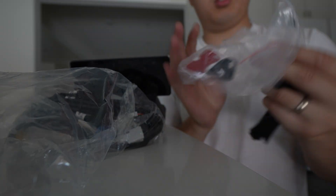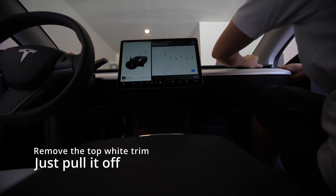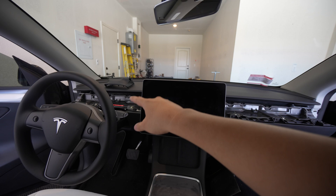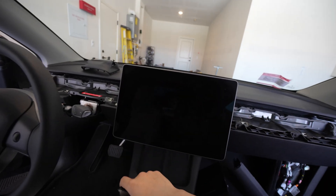You have this little camera and a B-mount that gets held by 3M or screws. To get started, just remove these panels — it's pretty easy. I'm going to use this tool to pry it open. With the panels all disassembled — front main bar, the steering wheel column, and this part also removed — now we can work on piecing everything together. This one goes over there and you'd have to reinstall the little fabric thing, but let's get to the meat and potatoes.